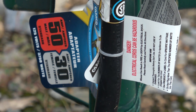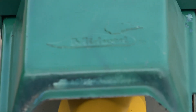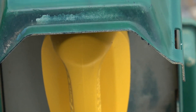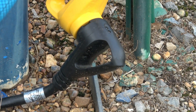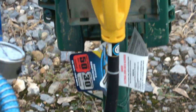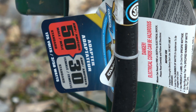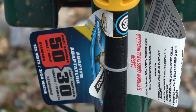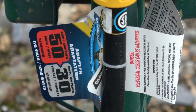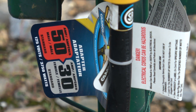So it's really important, and I'm sure glad that we got it. Basically what it does: you plug it into your receptacle, plug your connection into it, and all it simply does is reduce it from 50 to 30 amp — that's it, it's that simple. This is only the second time in the last year that Jean and I have had to use it, but I'm sure glad we got it.